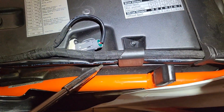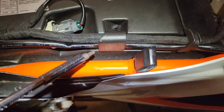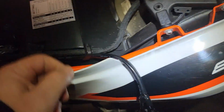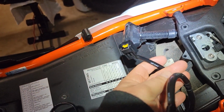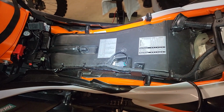And then you follow this, and you remove this. This goes into plastic, just a plastic screw, so when you tighten it up, don't go crazy tight or anything. Then the seat harness here easily tucks underneath this, and then I think it's time for us to plug into the seat with this one. So let's put a little dielectric grease on there and fit the driver's seat up.